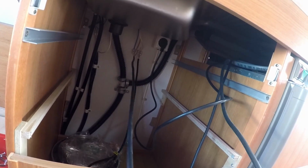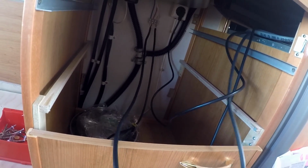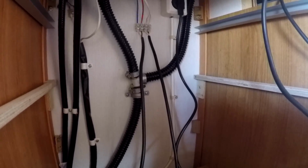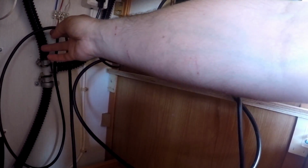If you think that, okay, that is the ground power, but still the 12-volt cable is pretty damn long. I think there is 1.5 meters or something, so 1 meter extra, and this is coming straight from the battery, so I'm trying to keep this as short as possible, because then we are losing more. The voltage is dropping when there is like 6 meters of cable. So if it's something short like this and goes straight here, it will be much better.